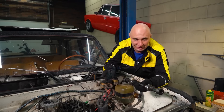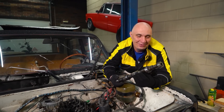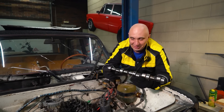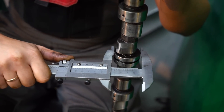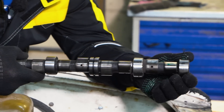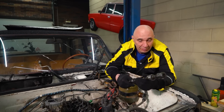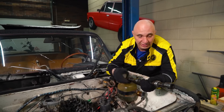So the timing would be where we need it, even if the firing order will be different. We spun this around and came to the consensus that yeah, that's how this is supposed to work. To successfully flip it, the journals vary in diameter. In order to tightly fit the bed, so to speak, the journals increase in size from one end to the other so that you don't install it the wrong way. And we can't just flip the retainer because then the bolt situation isn't going to work.